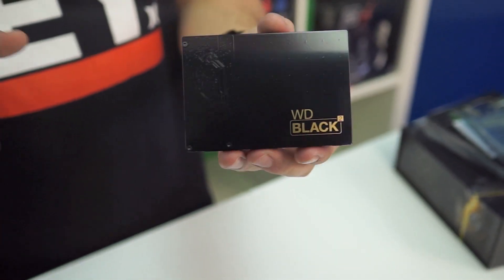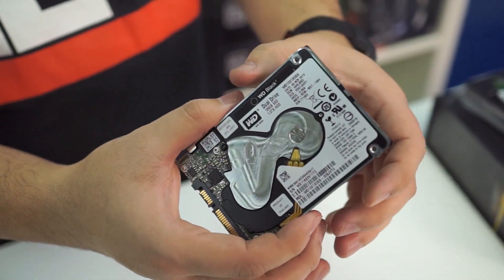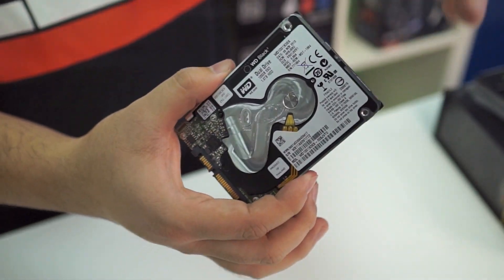I said 1TB hard drive. The top is the 120GB SSD and the bottom is the 1TB hard drive. Now when you first get the drive, the 1TB portion is locked, so you'll need to install the OS onto the SSD first. Once your OS is up and running — Windows only for the time being, no Mac support just yet — you'll be able to actually unlock the 1TB portion.